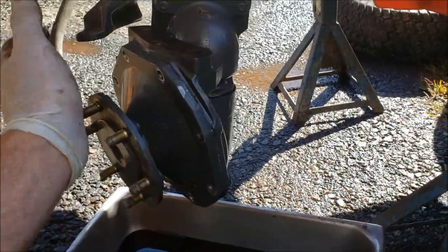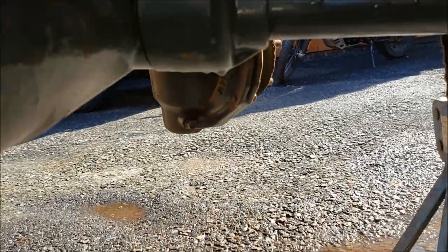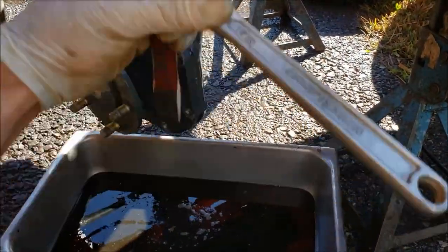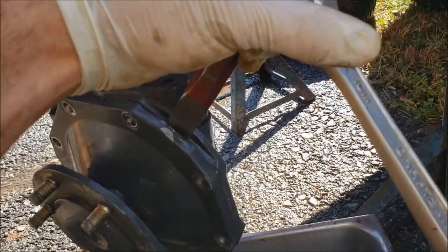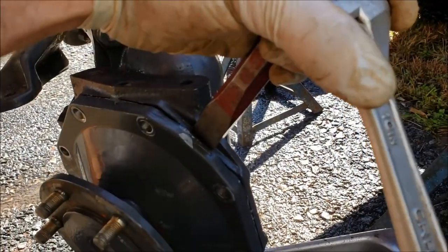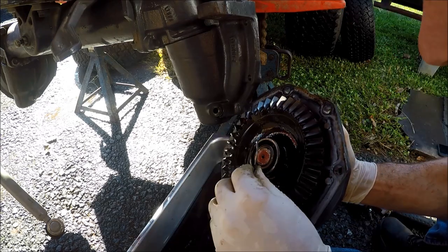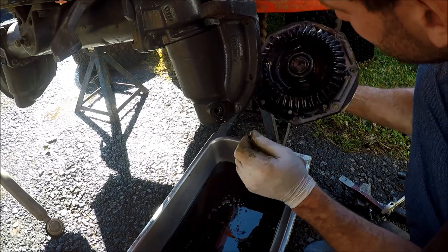With all that out of the way, we're ready to pop this apart. I'm definitely going to drain the other side too — make sure you drain both sides while you're doing this. Good idea to just do a full differential change. I found using this big flat chisel with a wrench on it to get this off works well. Don't go hitting this thing with a hammer — just put the chisel in there and twist it sideways and that will spread this apart. Something came out of there — had a shim sitting on the back there. Now this is where you don't want to get any dirt in this thing at all.